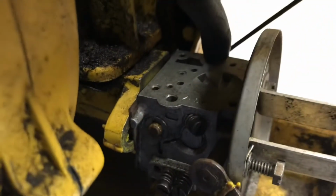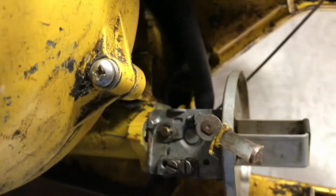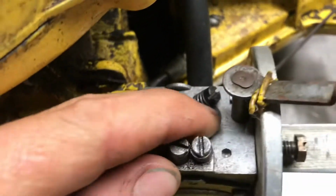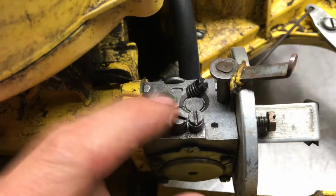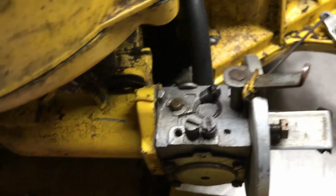But the first thing I'm noticing here, just off visually inspecting it, besides the air filters, is the metering side down here, and on top the fuel pump side isn't even on, but there's a fuel inlet, which is pretty strange. I don't know if that's what's going on there. I also don't know what type of carb this is. I think it's like a Walbro SDC or something like that. I've seen them with an accelerator pump, but obviously it doesn't have it because there's another screw that comes through here, so it's a pretty odd carburetor. I've never seen it before.